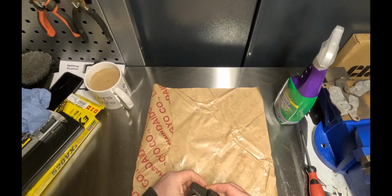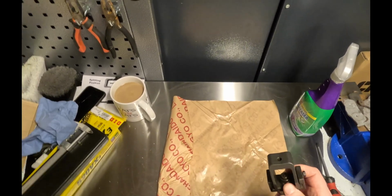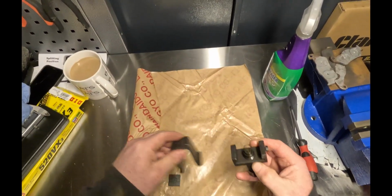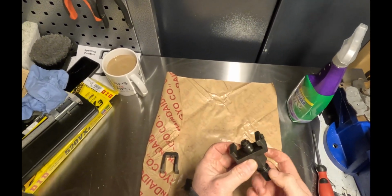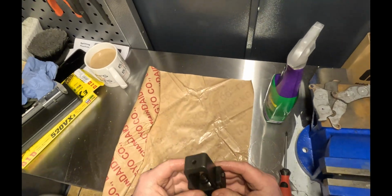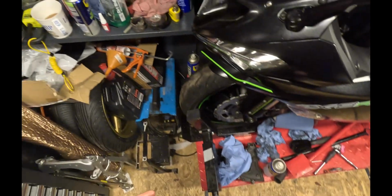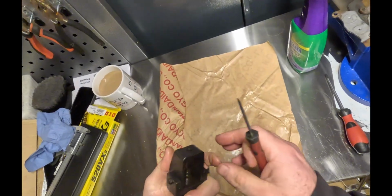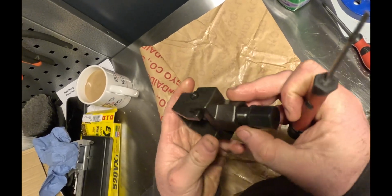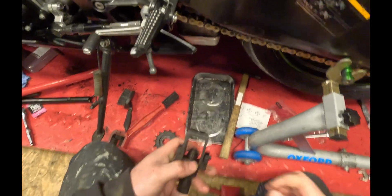Put that on the back, chain through here, push that through, lock it off, and use that to rivet. And it reduces some of the guesswork because you can only go so far with that riveting head. So when you rivet it, you see this little dome crown. When that flat bit then hits the side of the chain link, you can't go any further. So we'll give that a whirl now. So there's your bit.